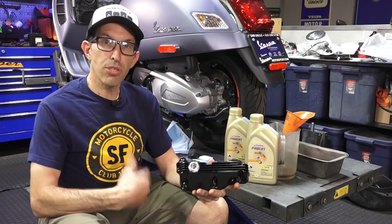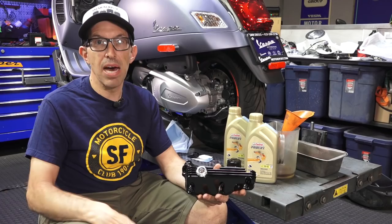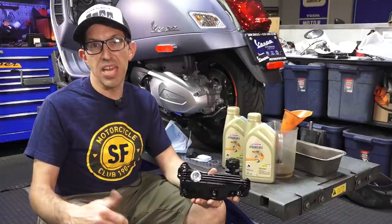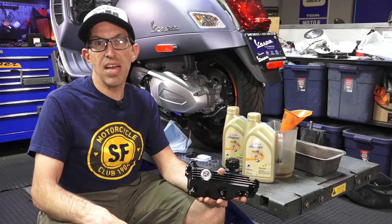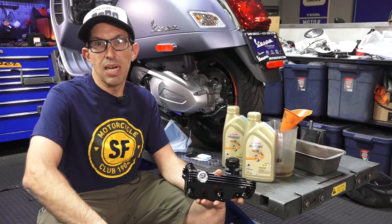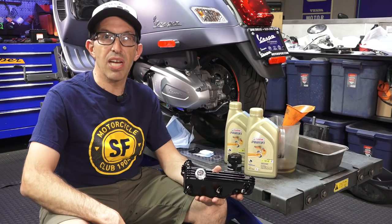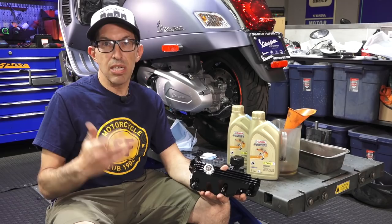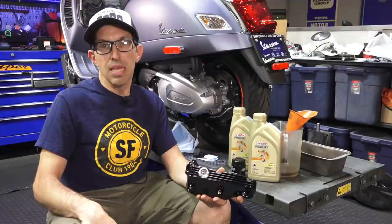If you've owned your GTS 300 HPE — in Europe it's a 2019 and newer model, in North America 2020 and newer — the downside of this newer motor is they do consume more oil than the typical older GTS 300. The older generation GTS 300, you could go about 3,000 miles of mild highway speeds without needing to top off the oil. With the HPE, you definitely want to be checking that oil every 500 to 1,000 miles and top off if needed. That's just normal operation of the motor. The same goes for if you have a Malossi or Polini kit installed — they typically use more oil.